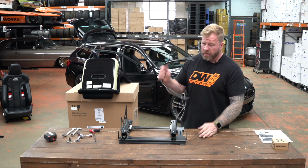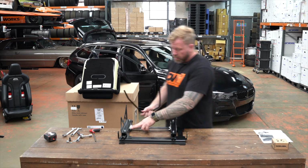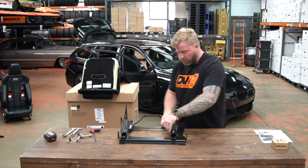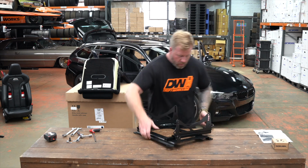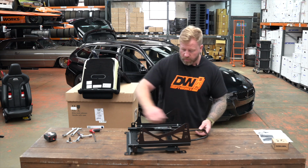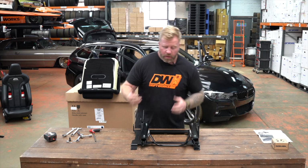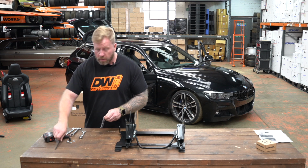Now the seat rail handle. It's just got a couple of holes in each side, and they correlate to the two pins on the lifting mechanism. I'm just going to push it in one side. It's quite flexible, easy enough to do. Slots in. And that then, lift that, the seat should go backwards and forwards. Which it does. Obviously, at the moment, it's going to be a little bit uneven because the seat isn't there to keep it parallel. Yeah, let's get the seat mounted.